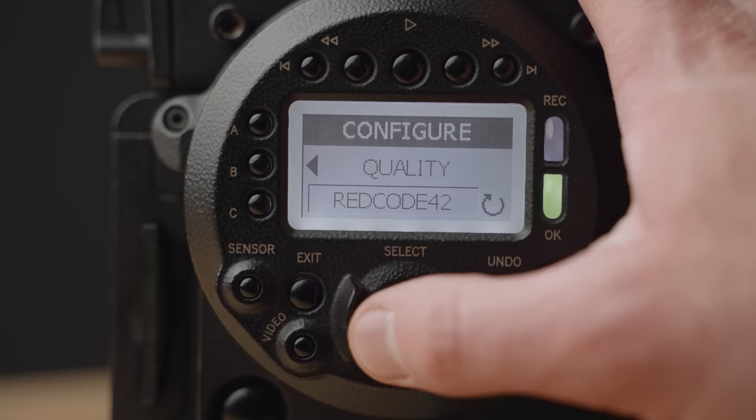The Red One is a pretty incredible camera even 14 years later, but it definitely has a couple of problems. First: the weight — this thing is just stupidly huge, definitely not a camera you throw in your backpack. Next is the boot time: it takes about a minute and 20 seconds from turning the camera on until you can start recording. Then there's fan noise — this thing gets hot so the fans run constantly. You can change settings to control how loud they get; silent mode will have the fans screaming while idling but almost shut off when you press record. Audio is also not great on this camera, especially the first version, so I'd recommend just using an external recorder.